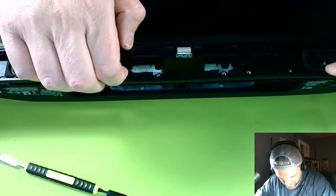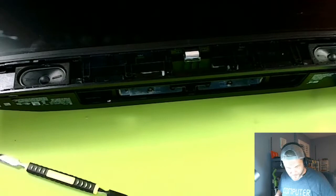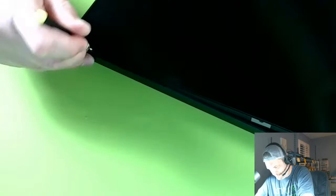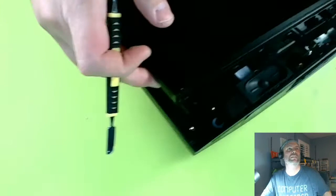I'm pretty sure. I might, you know what? I'm doing this all from memory. Okay. So that's why I think you do have to pop this. Oh, yeah, okay. So you do gotta pop the screen open here. So get this bad boy popped. There we go. Boom. Okay, now it's coming up. And be careful. You're gonna have an LCD cable connected to the motherboard. So you don't want to rip that. Here it goes. Now it's coming up. See? And as you... Oh, there's another screw.